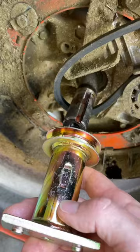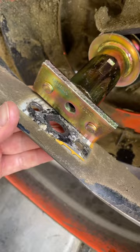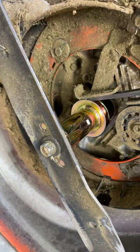With a little lube, I'm gonna go ahead and slide this thing on. Okay, she's bottomed out and the belt is also routed and the blade is also keyed. And I simply slide the bolt in, tighten it up. And with everything back together, let's go ahead and put this thing right side up and start it up and see how she feels. Sounds great.